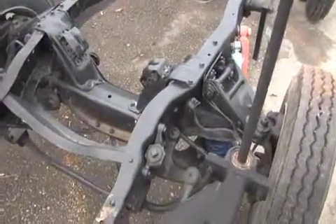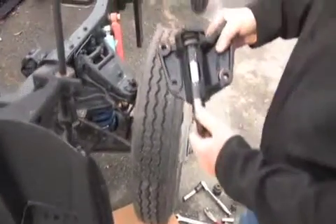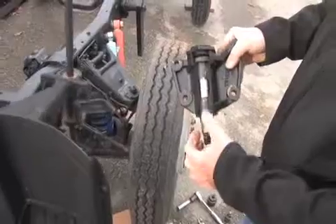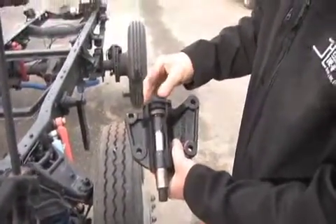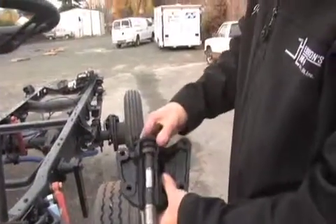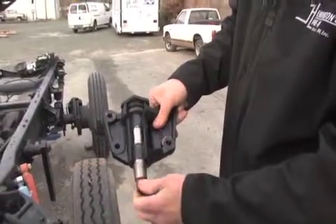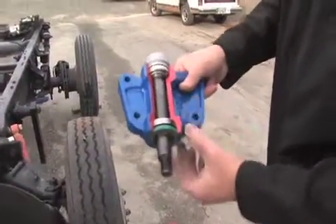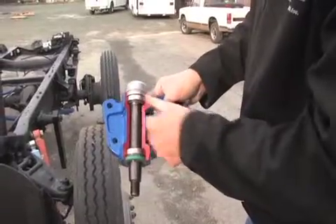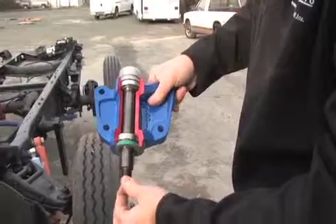On this original style bell crank, it's basically a flat pin and flat bushings. The OEM unit has an adjustment for up and down play, but you cannot adjust the side play out of it. Because it's a flat bushing and a flat pin, it has to have some clearance there to turn freely. What we've done with our bell crank is we've put tapered roller bearings top and bottom, with an adjustment on the top which not only will take end play out, it also takes side play out.